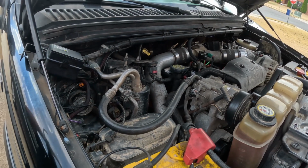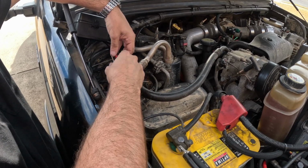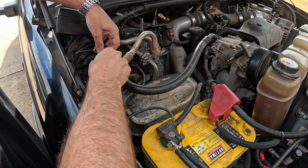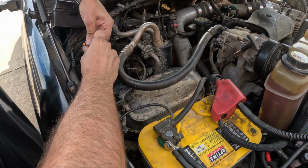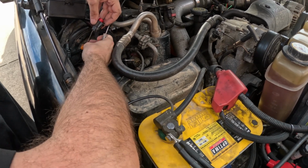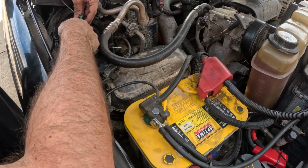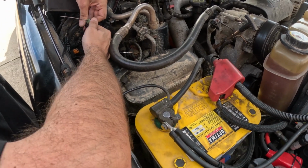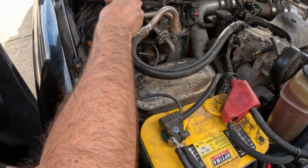Okay, we've got that over the splice. So the next step is to take apart this connector. First step I do is to take the, I guess you could say, the retainer off the back. There's two little tabs, one on each side, so I can do that with just a screwdriver. It'll then be captive on the black wire, so I don't have to worry about it going anywhere. And then that exposes the seal, so I can pry the seal out, and that gives me a view inside.